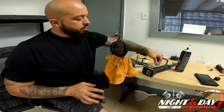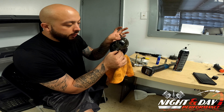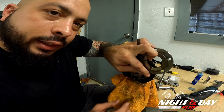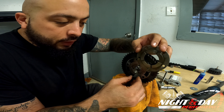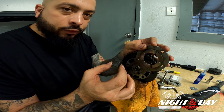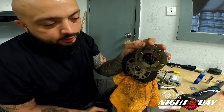We've got all that cleaned out. Now, where do we put our limiter? If you're having the lockout — the zero degree limiter — installed, it's only going to go in one slot, which is right here. It fits in just right; it is right below this bolt. If you have the line up at 12, it's below this bolt and goes right in. All the rest of the slots it will not fit. If you have the four degree limiter, it will slide in the rest of these. The lockout only goes in one spot, and this is where we're putting ours — it slides in nice and easy like that.